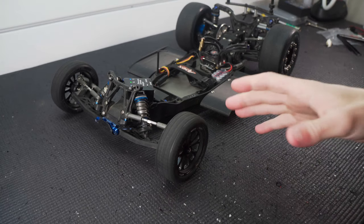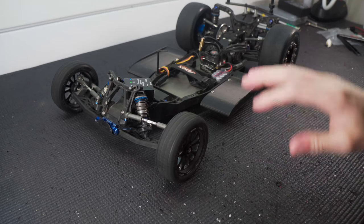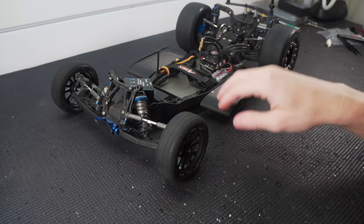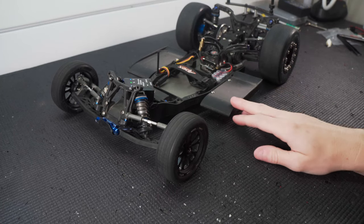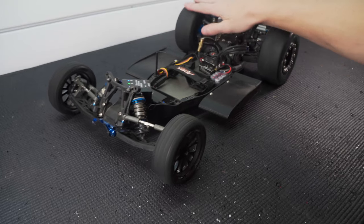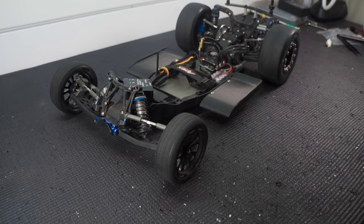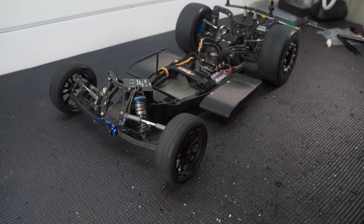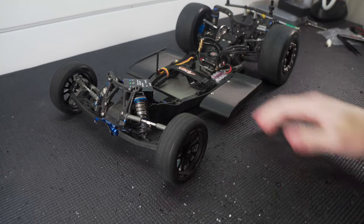I ended up running the same as I was before, 60 to 61 miles an hour. Those ETs were a little slower. I feel like I wasn't getting enough on the launch. You might have heard in some of the early passes today that I had some slipper clutch slippage. I had to tighten that up a little bit. I hadn't set it last time when I replaced this spur gear, I guess. Other than that, I'm pretty happy with the car.